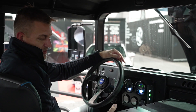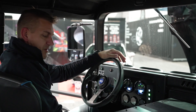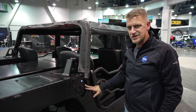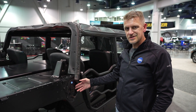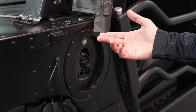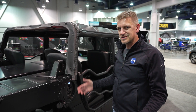We have a standard cable-actuated emergency brake. We wanted to keep that low-tech just in case a fault were to happen, so we always have the ability to brake the vehicle manually. Walking around to the passenger side, here's the charge port of the vehicle — we replaced the diesel filler port with an electric charge port. It's a standard SAE combo port with AC charge plugs and a DC charge plug, and it talks the J1772 standard just like any production EV. There's a status indicator so you can see if the vehicle is charging, done charging, or what's going on.